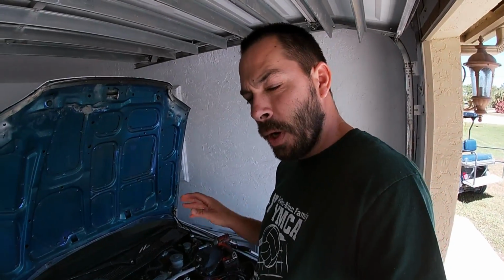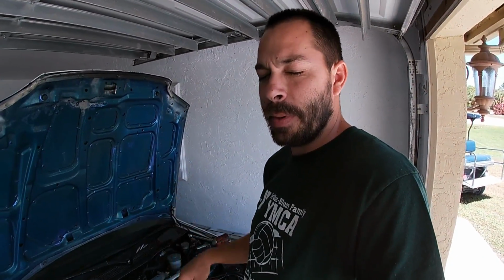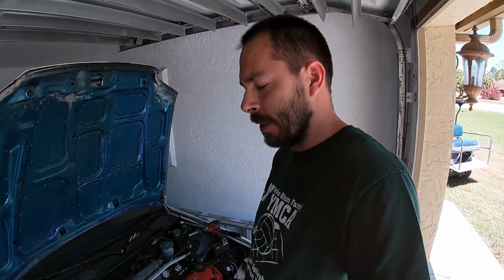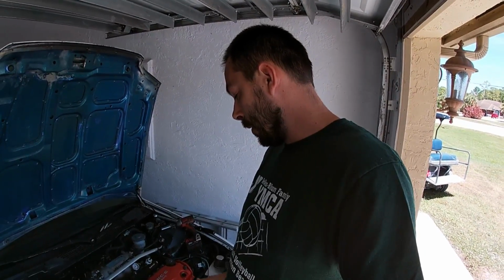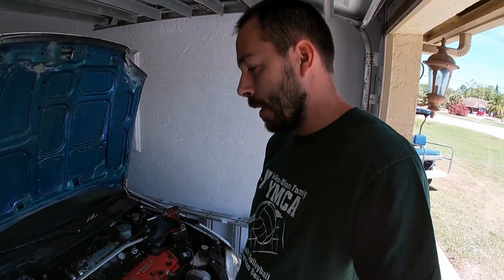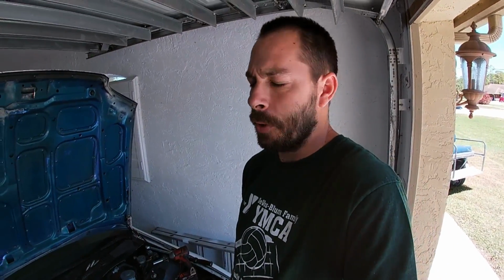piston melted. And then I welded that cylinder, fixed it, put another piston in, and it was running around for, I don't know, a month, month and a half or something like that. No issues. It did have what I thought was a piston slap on cold start. But once I drove around and it broke, now it's broke again, I realized it wasn't piston slap because cylinder 2 failed this time, and I'm pretty sure that piston came apart completely and just is all over the motor.